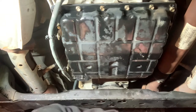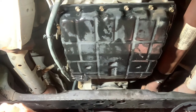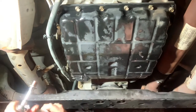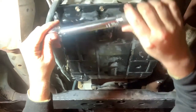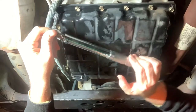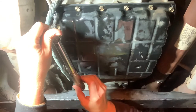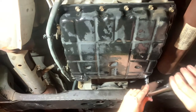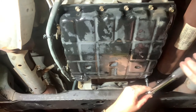These are only 70 inch-pounds, so you don't want to over-tighten them. All our bolts are in and snugged down by hand. We're going to torque them to 70 inch-pounds with a cross-torque pattern, which will seat the gasket flush and evenly. Hopefully we don't have any leaks. I'll repeat this all the way around, and when I finish the cross-torque, I'll go back to each bolt to make sure it held the torque.